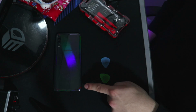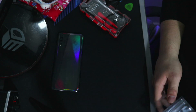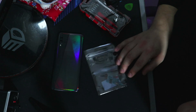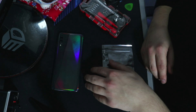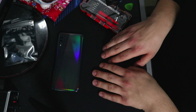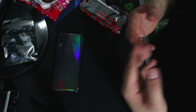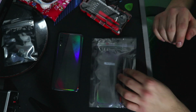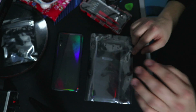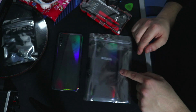This phone has been opened once before so it'll be a little bit easier. I've found a little notch right here where I can get my guitar pick under and pop it up. For starters, I have got the Galaxy A70 charge port replacement. It's good to find out what part you need — in Samsung phones there's a setting where you can go to About Phone and check the part number to make sure it matches. I've also got a new battery cover since the back plate is a bit scuffed.